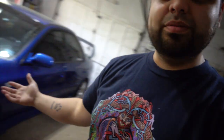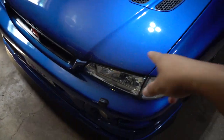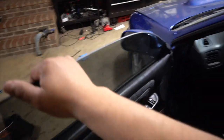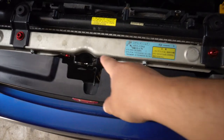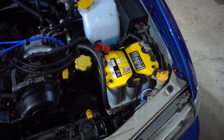As you can see I've changed — it is now the next day. When something bugs me, it bugs the crap out of me. I said I was going to fix the car after the washer sprayers but last night it just bugged me too much, so I got it done. I got the fender liner on and I also rerouted the hood latch cable — now it's tucked away where it should be. It also pulls a lot easier now; it used to crunch because there was so much tension on it.